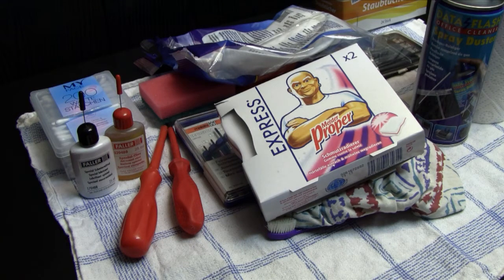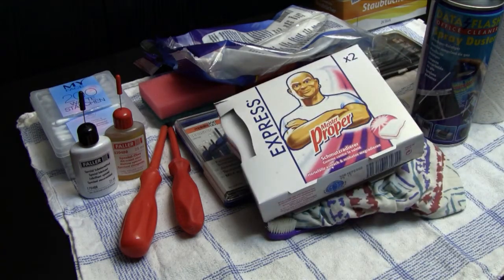And actually some people also say you can remove scratches with this magic eraser, and yes, you can do this, but only in combination with car polish, at least in my opinion, because I actually tried it, and I'm gonna show you later on what I mean. Just with the Mr. Clean Magic Eraser, since it works almost like a very fine sandpaper, it is true that you can remove the scratches, but without polish you won't be satisfied with it. But like I said before, I'm gonna show you later on almost all the things that I've showed you before in action, and how I use all those tools and all those cleaning agents.